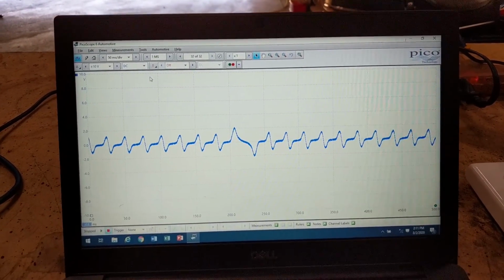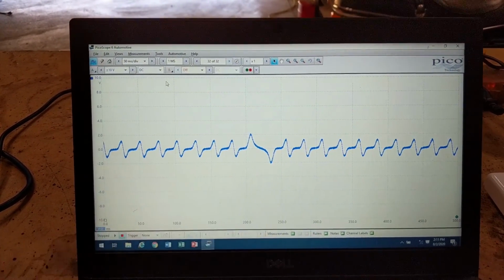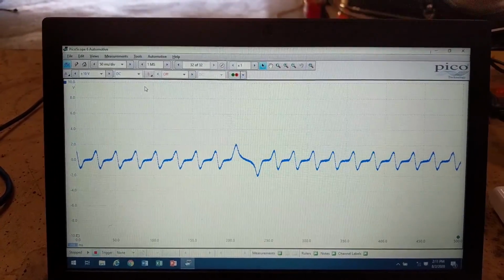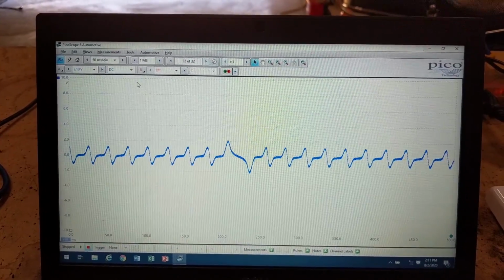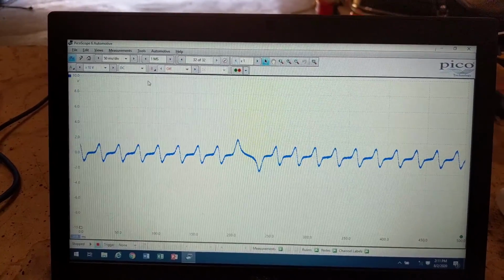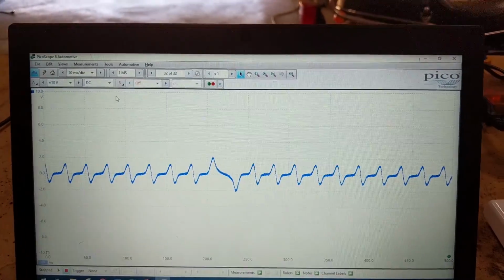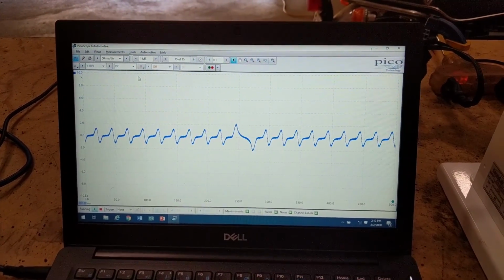So what we're seeing is that analog signal of the magnetic field being interrupted by the tone wheel, and then where the dead spot is, that magnetic field is building up, and then it's interrupted after the delay once the next tooth on the tone wheel cuts through the magnetic field. This is going to cause a spike in the voltage, and this is an AC generator, so we're going to get a spike positive and a spike negative. Then it's going to resume the normal waveform for the duration of the tone wheel until it comes back around to the fault.